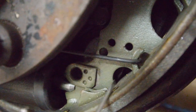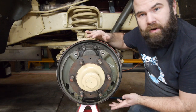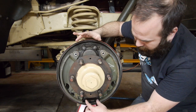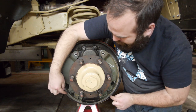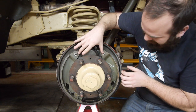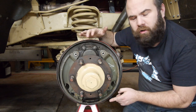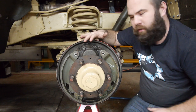It's a little hard to see, but the disc here pushes in and out the brake pad when you adjust brakes from the outside. The Unimog brakes are designed in the 1950s — there's a fixed point here and only the cylinder on this side, so when you brake only this part moves out. On more modern drum brake systems both sides push out, so wearing in the brake pads in the new drum will take longer than with a modern system.